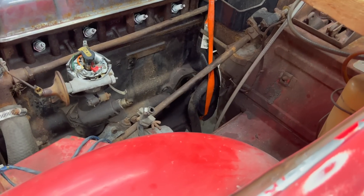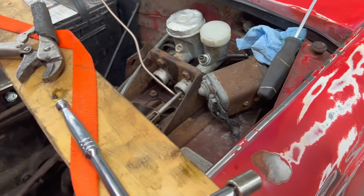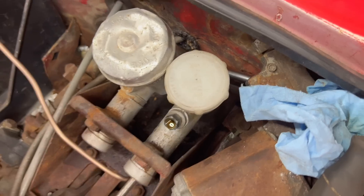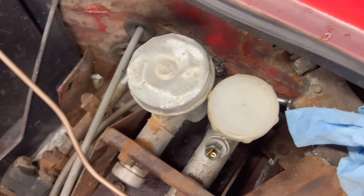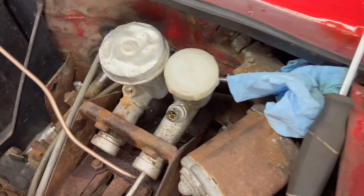Taking a little break. Alin's got all the brake lines done with the exception of the one running from the master across. It's a big pain to get the master cylinders out with the bottom bolt being pretty inaccessible. We're seriously thinking about dropping it from the pedal box inside the footwell to be able to get those bottom bolts out.